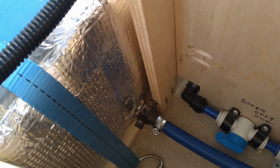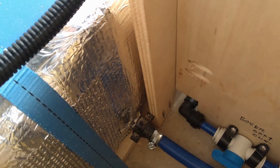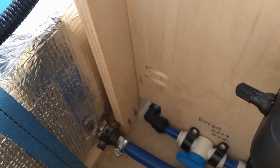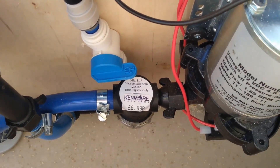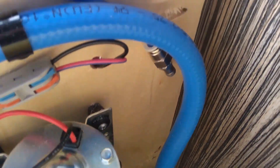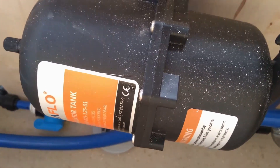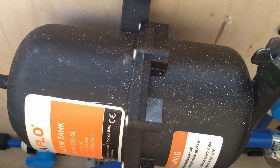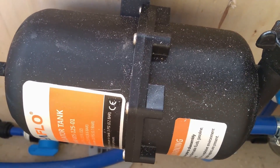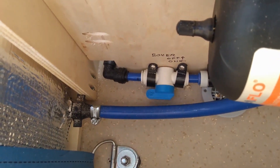The outlet is at the bottom — somebody asked me why not have it at the top. There was a logical reason for it at the bottom but then I changed how we did all the plumbing and that reason went away, but I forgot to rethink it. We then have a water filter that filters the crud out from the tank. Note that this is on the low-pressure side, so it's pre-pump. Then we have a 30 psi diaphragm pump that works on pressure and sends the water through an accumulator. The accumulator is about 50% full of air with a diaphragm inside — when the pump runs it pressurises this, so when you run the tap it depressurises first and gives a nice smooth flow rather than pulsing, which you typically get. That works really well. From there it drops down into the 12mm push-fit system — I would recommend 12mm push-fit, it's brilliant, and I've had no leaks from it.